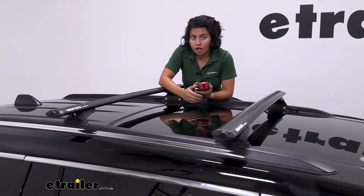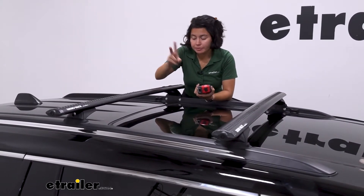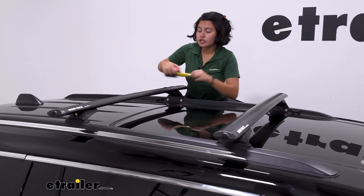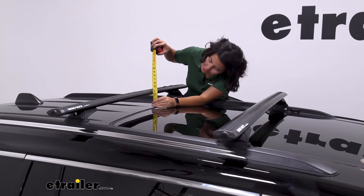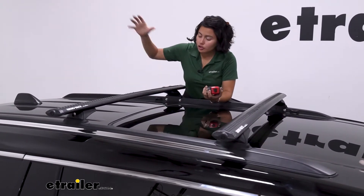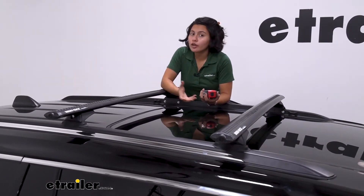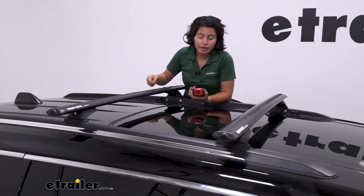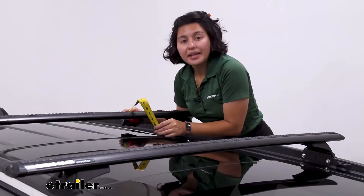You have a glass roof on your Grand Cherokee L, so you'll want to make sure you have enough clearance. There are two clearance measurements. The first is measuring from the roof to the bottom of the crossbar — I have it at about three inches, or just a little less than three inches. That's how much space you have for clamps that go around your crossbars. If you have entry-level ones with U-bolts and wing nuts, you want to make sure that's enough space — this is pretty average for a roof rack.